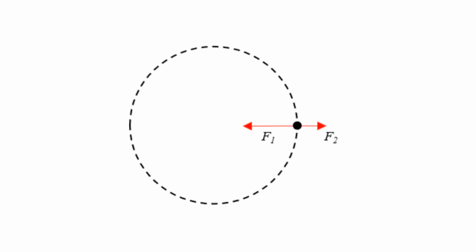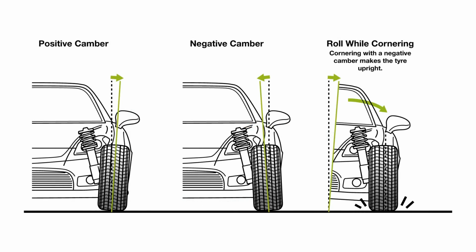You've probably experienced this when going quickly through a traffic intersection. Your body always leans opposite to the direction you're turning. The tires also experience this force, which results in tire lean. If the tires were flat before a corner, you'd be putting excess force on the outside of the tire during the corner, and you wouldn't be achieving optimal grip. By putting some negative camber in the setup, when you go through a corner, the camber will counteract the tire lean, and your contact patch will be maximized.